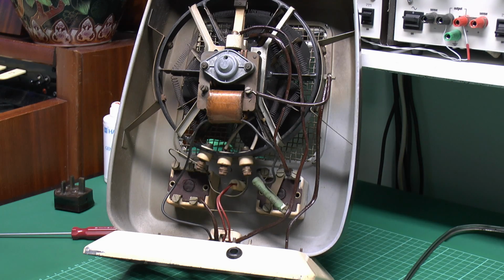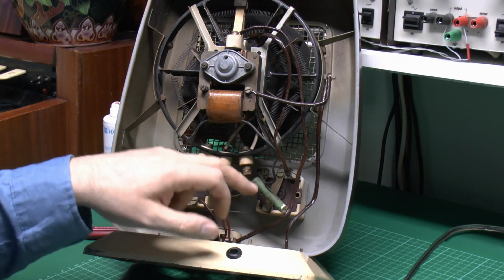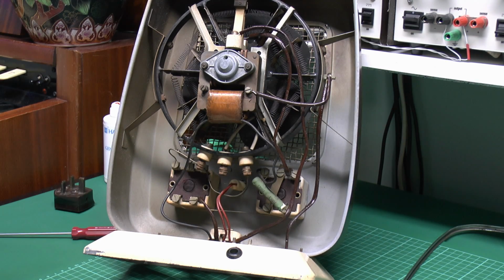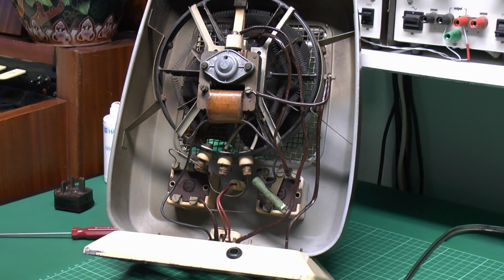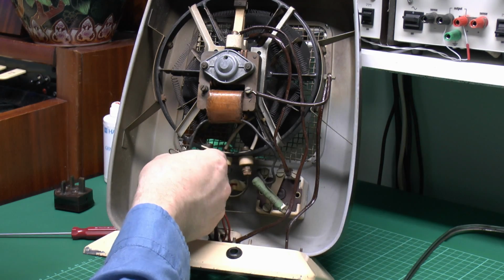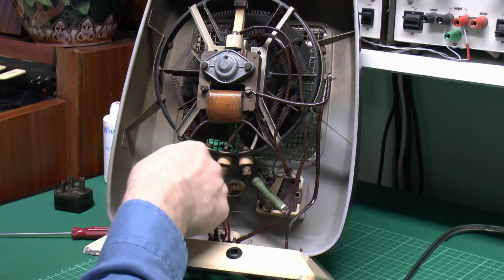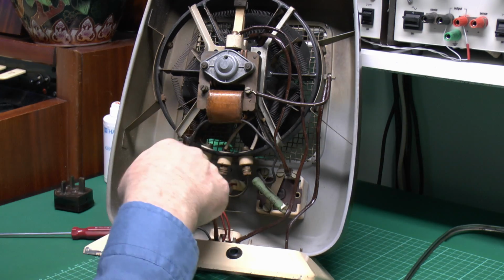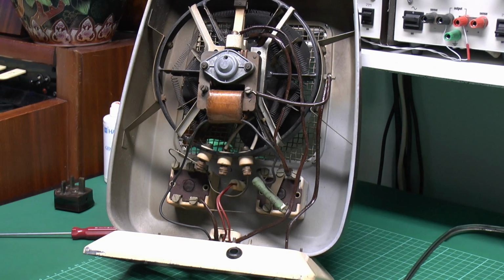Now the wiring inside isn't actually too bad. We've got these 2 black wires here, which are obviously for the motor here. This one is just directly there. The other one obviously via this resistor arrangement, so you can get the various different speeds, say 3 speeds here, so it's either direct on or with one or both of those 700 ohm resistors. And so they're reasonably okay there, and they actually appear to be plastic coated. They're not actually rubber, unlike the flex which came in, so quite happy just to leave those as they are. And of course they're well away from the heating elements anyway, they just obviously come down, and the heating element obviously at the top, so not a problem with the heating on those ones.